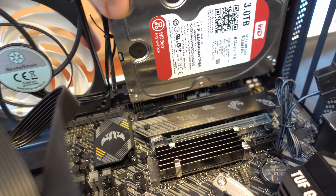I'm worried that the high definition audio cables passing by the fan might generate a little bit of noise in the line. Another issue is that down there, under the fan, there's one of the case fan connectors of the motherboard. I could make a cutout there, but it might interfere with the fan blades, so I'm not going to do that. I will probably feed this fan off the other case fan header that is also used for the rear exhaust, and for the side panel fan I'll use the secondary CPU fan header instead. It's not the most beautiful solution, but it might end up in an at least temporarily functional case.